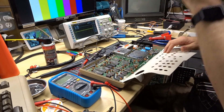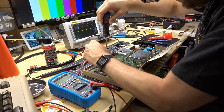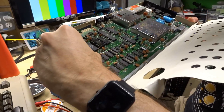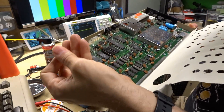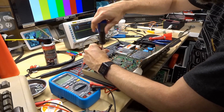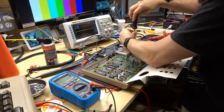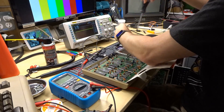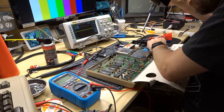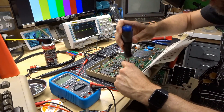It's got all the chips, and it has some sockets, which means this thing has been reworked. At least it has screws holding in the motherboard. Look at this — there's a screw just lying right on the motherboard. It's a good reason why when you get these computers you should open them up right away, because that screw could have easily shorted something out. This appears to be the same revision board as my ZIF socket machine, which is good for comparison with the logic probe. From a socketed perspective, nothing is socketed except for the kernel ROM and the VIC-2, and then there are two logic chips here.